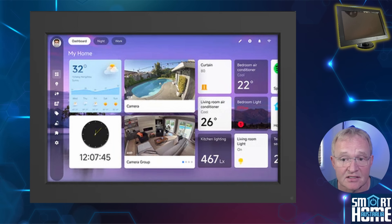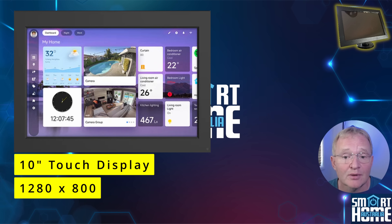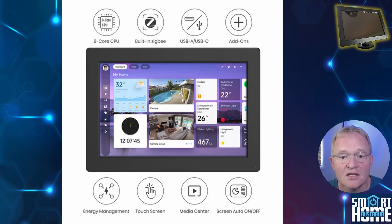Now let's look at the hardware in more detail. The ISG Max is a 10-inch bright touchscreen display with a resolution of 1280 by 800 and a built-in brightness sensor to adjust the screen brightness for optimal viewing conditions. You could think of the ISG Max as a Home Assistant Green with a super bright 10-inch screen bolted to the front and a powerful ISG software wrapper around Home Assistant running in a container. Inside the unit you get an 8-core CPU, up from the 4 cores of the ISG. The RAM remains the same at 4 gigabytes along with 32 gigabytes of storage, which falls in line with competitors such as the Home Assistant Green, although there is an SD card slot that allows for additional storage. Connectivity is provided by one USB-A and one USB-C, which can be used to power the device.